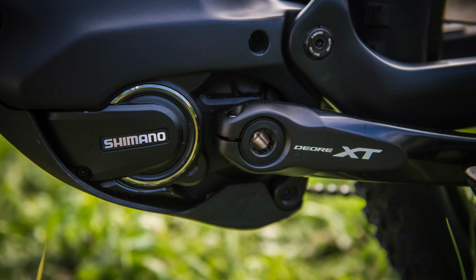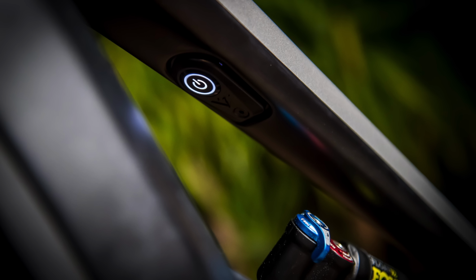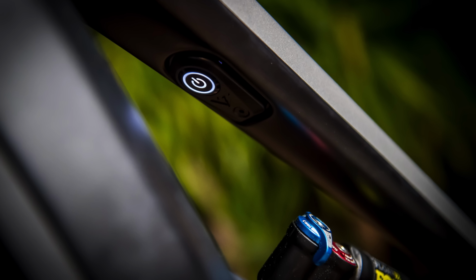So it was fitting well with the bike first, because we got the chance to position the pivot point for the chainstay where we like to have it, to reduce the anti-squat and extremely reduce the pedal kickback on the bike to help the engine run smoothly. And this was one point. And then Shimano knows what mountain biking means. At the moment, I would say, they are the driving company for EMTB motors, because they have done mountain bike stuff since ever, and when you see the product, you understand it, and they have a really stable quality. And this is a really interesting thing.